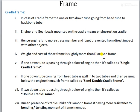The weight and cost of the cradle frame is slightly more than the diamond frame, because the fourth member here is not an engine but an additional tube, so material increases slightly and cost increases slightly. If one down tube is passing below the engine, it is called a single cradle frame. If the down tube from the head tube splits into two tubes, it is called a semi-double cradle. If two tubes come directly from the head tube and pass under the engine, it is called a double cradle frame.